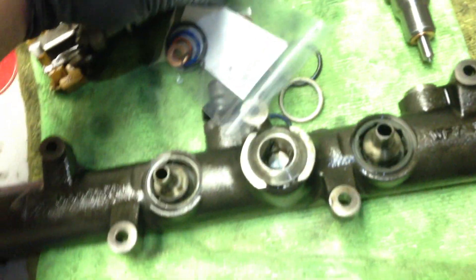It took me a long time to research this because Ford doesn't want to sell you these o-rings — they have Motorcraft, and Motorcraft remanufactures injectors for them. So they do not want to sell you the copper one; they do not want to sell you this black one at the top of the injector, which basically saves your injector for at least another hundred thousand miles, maybe more.